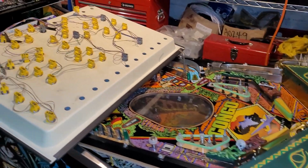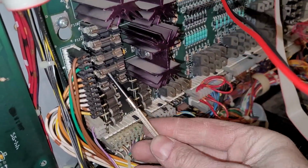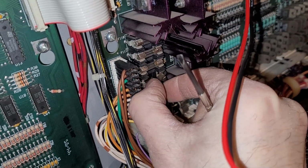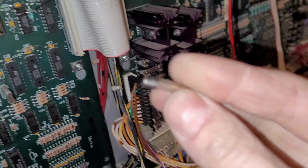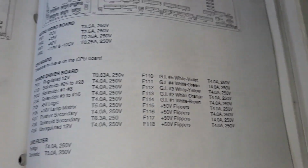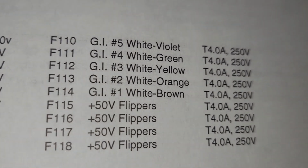Here's your pro tip of the day. When dealing with stuff like this, turn off your machine, because otherwise you blow fuses. And in the case of WPC 95 games, it's these silly little mini fuses, which I don't even know if I have in stock. Yep, she's dead. I thought it might have been bad when I saw a little spark under the playfield. F113 apparently is a 4.0 amp fuse. So, follow me.